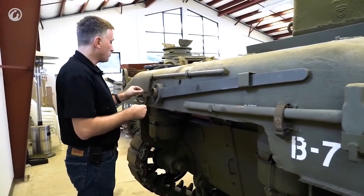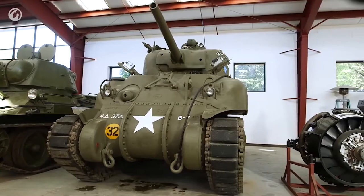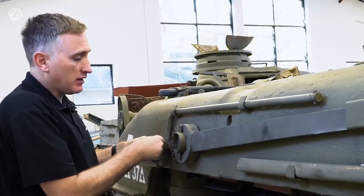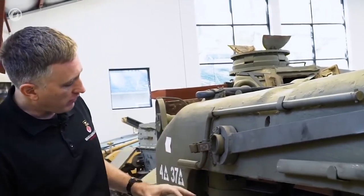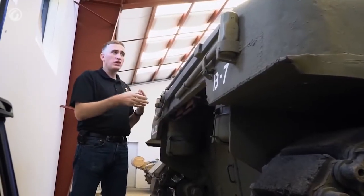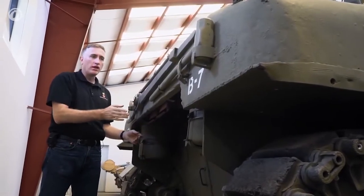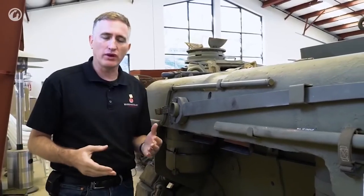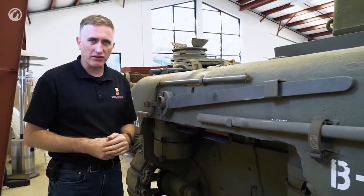Of course you wouldn't have to do this if the engine was warm, but I have no doubt that the crew was very happy to get engines a little more modern later in the war that you didn't have to do this every time. The M18 gun motor carriage still had the radial engine. While I'm back here, you'll also see the large air filters and exhaust ports — the cooling air would be blasted through the big gap between the roof and the back wall, deflected downwards right into the dust and dirt, signifying your position to anybody within miles in North Africa's desert.